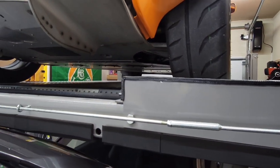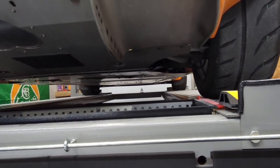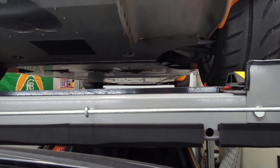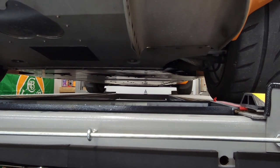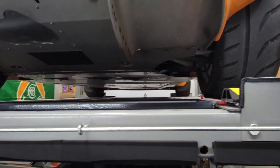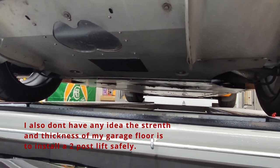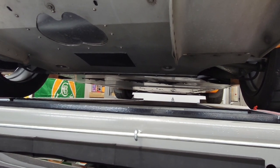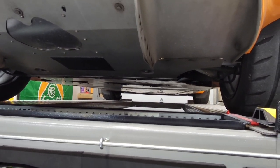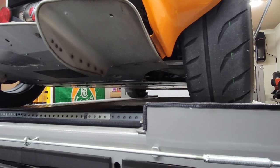The reason to get this lift — if you do some reading on the Lotus Elise, Elises and Exiges have a specific way to lift the car. There are jacking points and lifting points, and I didn't want to do a two-post lift because you still need to remove the under panel and access the middle part to properly get to the lifting points. There is an aftermarket bracket they sell to add another lifting point, but ultimately I think the four-post lift gets me comfortably working on it.